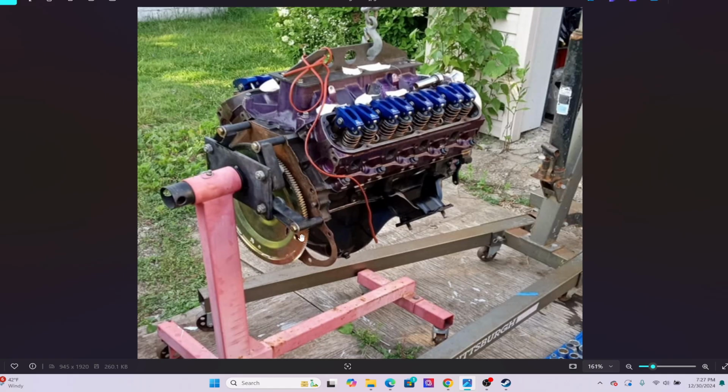And at first I was nervous because it seemed like it really had minimal play when I would move the torque converter forward, and I was like, oh no, I hope that I had it seated all the way, because that's the thing when you're installing the torque converter, you have to do a few turns, push it, and keep making sure. And the way you make sure that it's seated is you take a straight edge or yardstick or anything you can get, and just make sure the torque converter is basically behind the bell housing.